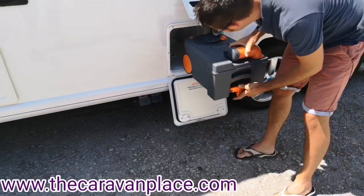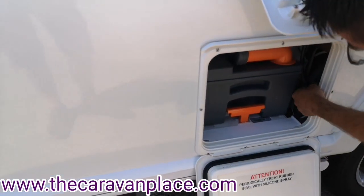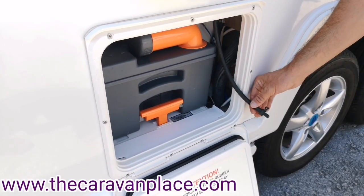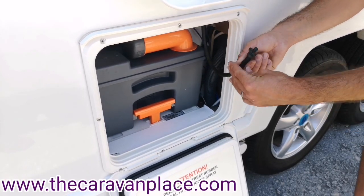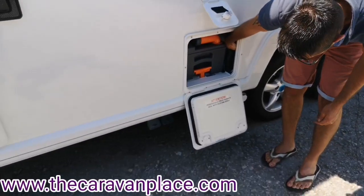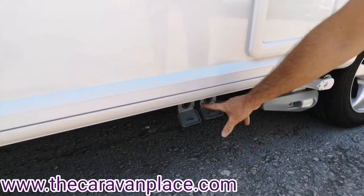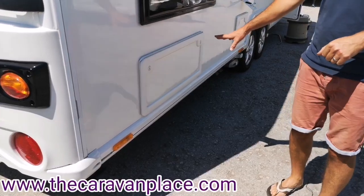There is a little bit of fresh clean water in the cassette with a slight amount of blue chemical. For draining over winter, tucked down the side is the drain bung or drain hose — the cap comes off and that drains the cassette. If you're not going to use it for a couple of months it's worth draining it off; then cap goes back on and clips back in on the side. Further along we have two wastewater points — your wastewater pipes go in there and into your wastewater container. There's also another small storage locker underneath one of the back bunk beds.